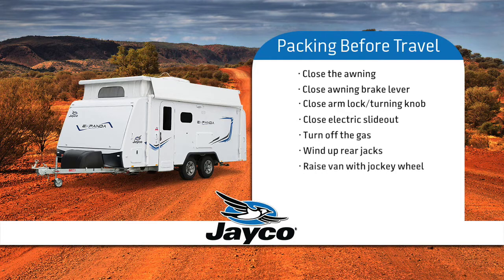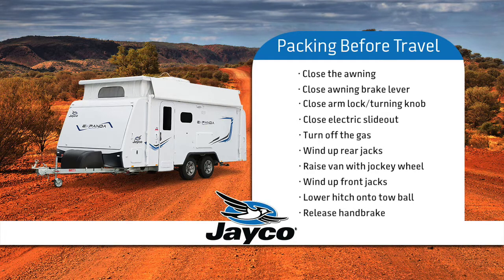Put the jockey wheel into the bracket and raise the jockey wheel until it is lifting the front of the van. Wind up the front jacks. Lower the jockey wheel so the hitch on your van can catch onto the tow ball. Release the handbrake.